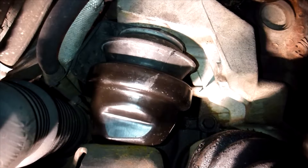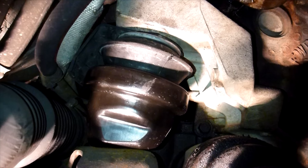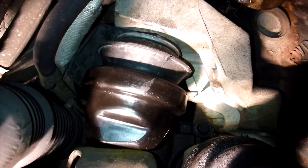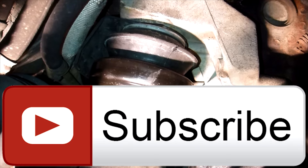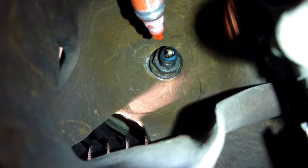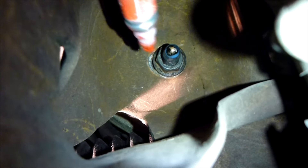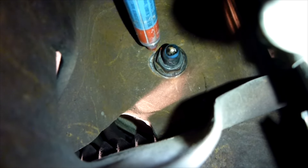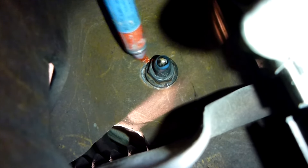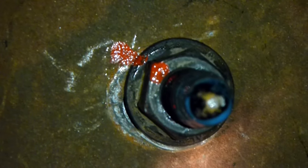And we are officially done. That's how you replace a motor mount — see how simple it is? It's all about having clearance. If you have clearance to get to those bolts, this job is simple. Now that you know the basic idea, you can apply this to any vehicle. You saw how it was done on my 95 Ford Windstar. Hopefully this video is helpful — if it was, remember to give it a thumbs up, and hit that subscribe button. The top tip for this video: this is a very high vibration area, so as a precaution, you can get a marker and mark where that nut is against the frame. Anytime you go underneath the car, you can see if it moved. It's a simple thing for peace of mind — and you can also do this for any suspension bolts you take off and put back on.